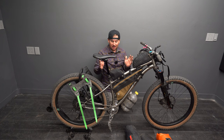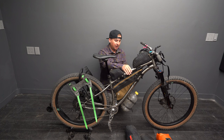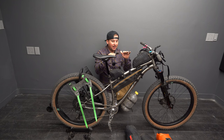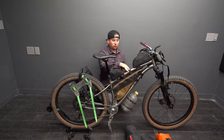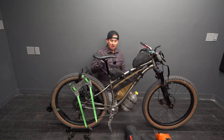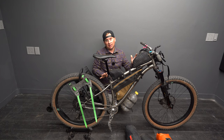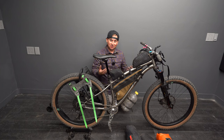This is my bike that I designed, the Binary Maniac. I made it out of titanium because straps are going to go on it, and when you hit a whole bunch of washboards, even if you don't see movement on your bags, they're vibrating and they're scratching. Paint, clear coat, carbon even — I've seen straps wear through carbon and make a hole in the frame. So I personally don't recommend carbon frames for bikepacking unless you wrap the entire thing in electrical tape. I'd rather have a titanium frame that I can buff out at the end of a trip and it looks as good as new.